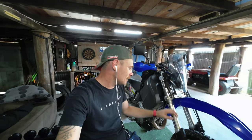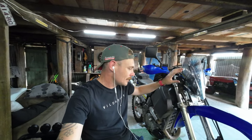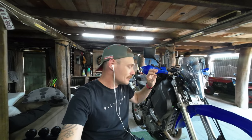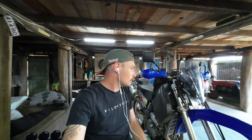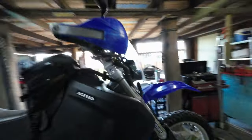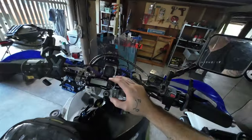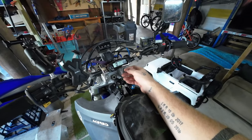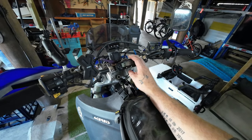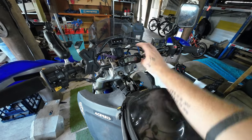The biggest difference to my steering has been when I put these big forks on. They're longer than the stock ones, so it's lifted the front of my bike up. It makes the headlight angle terrible, but it's improved the steering on the bike tenfold. Compared to the factory setup for my riding, I love it — it grips so much better on the loose stuff in the corners, and these forks are nowhere near as wobbly as the stock ones were. Spinning around to the back — I run a Trailtec Endurance 2 for my speedometer. The DR is a simple beast; it doesn't have a tacho or anything from factory, so the Endurance 2 sorted me really well. It's handlebar mounted, and in this position I can see it when I'm standing or sitting.